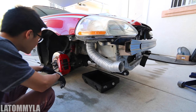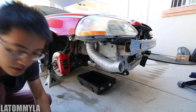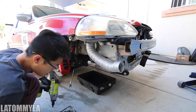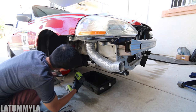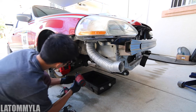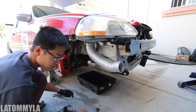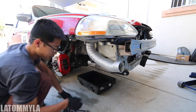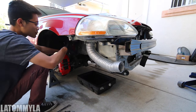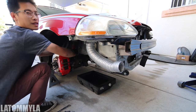I switched back to the 70D - like the quality better. Now I'm going to take off the fork, which is of course a 17mm. I'm gonna be lazy and use the impact. The construction in my area never stops, it's so annoying - there's a truck coming right now carrying dirt away. I'm gonna be lazy today because my shoulder hurts. I have a lot of shoulder pain right now, but I need to get this done because it's my only car, it's my daily. And this isn't really a hard task - if you guys do it yourself, it's pretty easy.